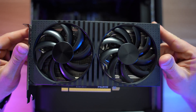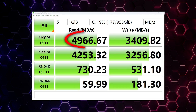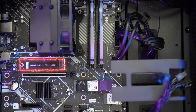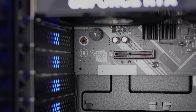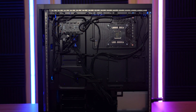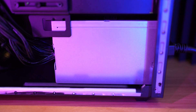Nothing too special about this design — pretty basic. Behind that GPU is our main SSD, which is a 1TB Western Digital, with about 30% lower speeds than the top tier PCs we normally review: almost 5GB per second read and 3.4 write. Looking at the motherboard more closely, there's another slot for an additional SSD, and thankfully that one is accessible without removing the GPU. There's also an extra available PCIe slot at the bottom if you plan to use a capture card. Swinging around to the back reveals not-too-clean cable management, two additional 2.5-inch SATA SSD bays, and two more slots for traditional 3.5-inch mechanical hard drives. In the bottom right, we've got HP's proprietary non-modular 80-plus gold 600-watt power supply.